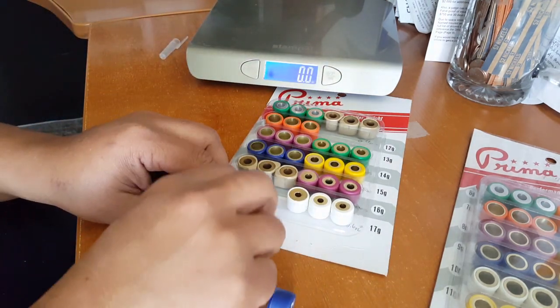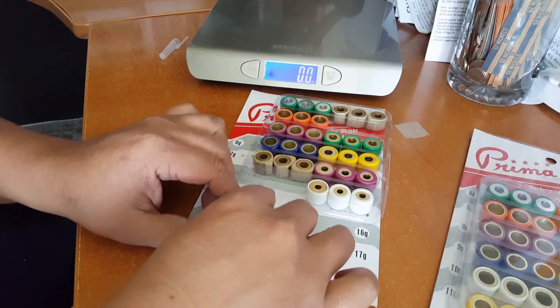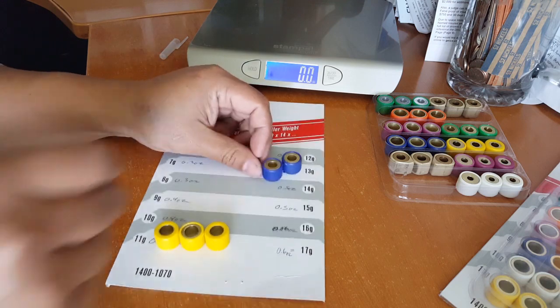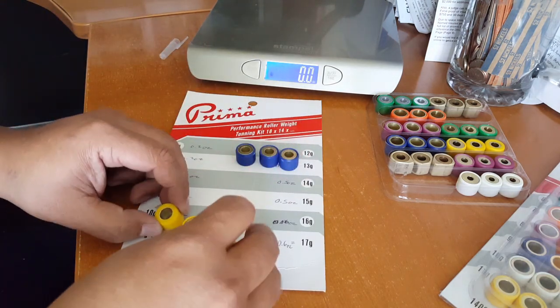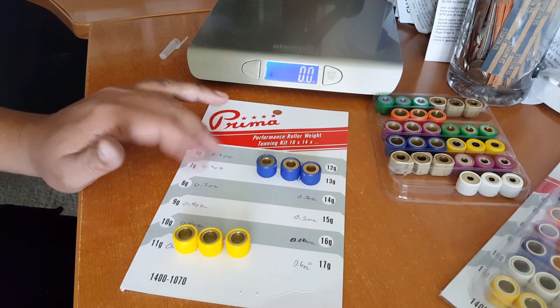It is pretty much the yellow, and the yellow is our 11 gram ones. And then our 13 gram ones were our blue ones. So this is what it would probably take to actually get our scooter to be 12 grams. Just trying to keep the same consistency. So this is what it would have been. This is the actual real color for it.